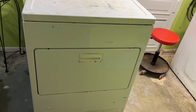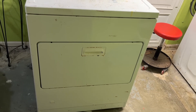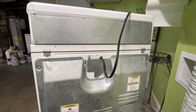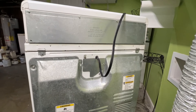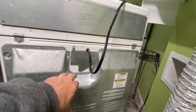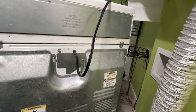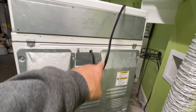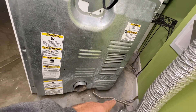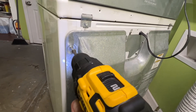It's quick and simple and doesn't require any special tools really, other than a multimeter so you can check for continuity. With a dryer there are about 9 or 10 screws that run around the perimeter, and you actually have to take off this panel too because that screw holds into here — three up each side and then three in this area. You take your exhaust hose off, I've got my gas line turned off, and of course remove your plug from the outlet. These are quarter-inch hex heads.